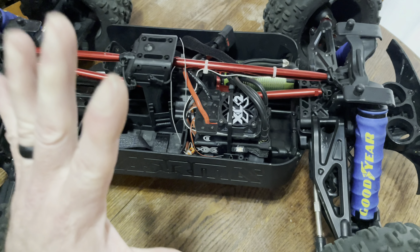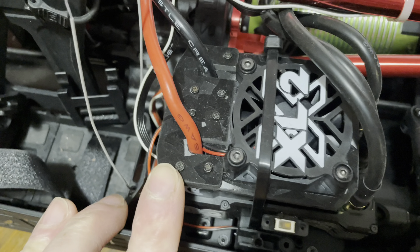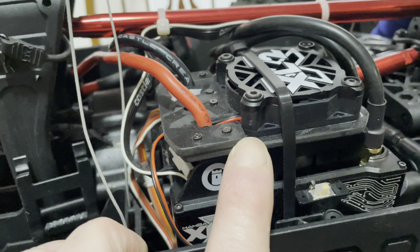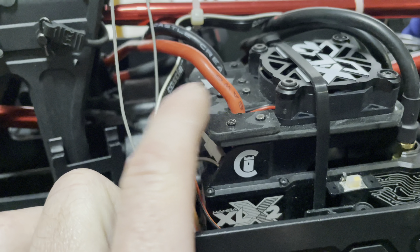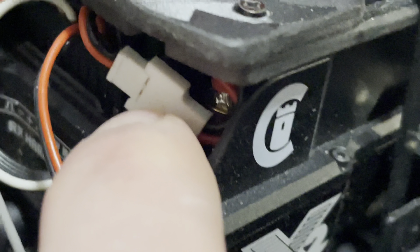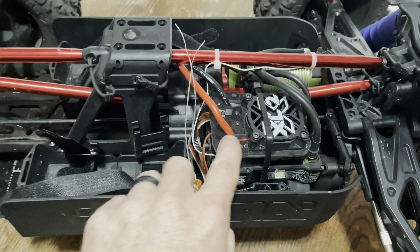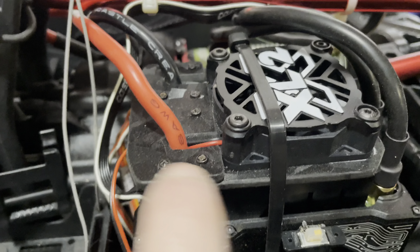One more thing I want to show you guys — don't forget to check out my video where I make this plate for the XLX2. Anybody who has had an XLX2 crash, whether it's in your truck, your speed runner, or one-seventh scale — when these take a tumble, these wires rip off. It's going to be the positive or negative, and it's because these power terminals are really tall and they've got a lot of leverage. It makes it so that if a battery comes dislodged, or there's flex in the chassis, just the weight of these connectors flapping around will dislodge it.